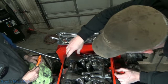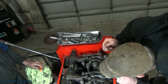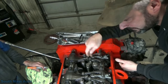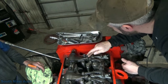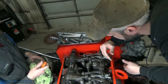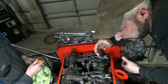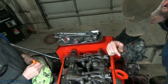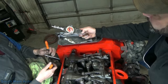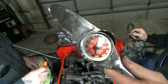One thing I observed is the plunger for the injector is almost at the peak of its apex — so the injector is plunged right now. I assume these are not set with a valve lash method — no, they're set with a torque method of 70 inch-pounds at the bottom of stroke. You loosen the jam nut, tighten the center nut to 70 inch-pounds. You can't use a click-type torque wrench for that adjustment — you need a dial-type torque wrench.